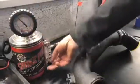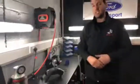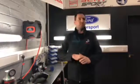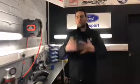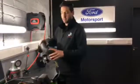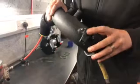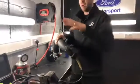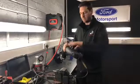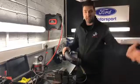What boost leaks do is this: let's say in the ECU we ask for 1.5 bar of boost. The wastegate will shut and the turbo will try to get there, but it will never achieve 1.5 bar. This sensor here, called a manifold air pressure sensor, is in most charge pipes, and could be on the inlet manifold or slightly after the intercooler. It measures how much pressure there is inside this system. If it doesn't reach the desired pressure from the ECU, say the 1.5 bar, it will flag an engine management light.